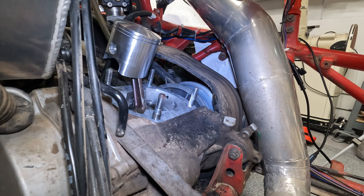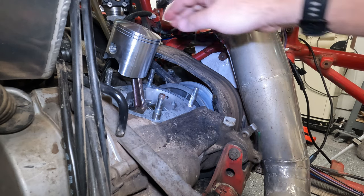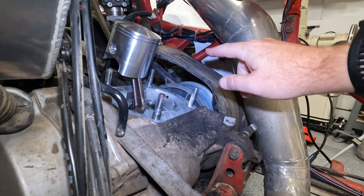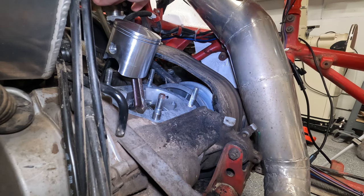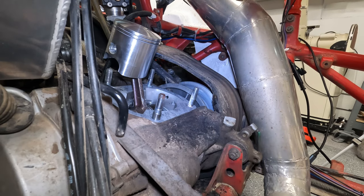But one of the things you do want to do, if you've not replaced it, is the pulse line for your fuel pump. It's the vacuum line. You want to replace this, and this is a great opportunity to get in here and tighten this. If you haven't replaced it, it'd be a great thing to do. So I'm going to pause here. I've got to get some other things taken care of, and then we'll be back in the next video to put the rest of this back together.